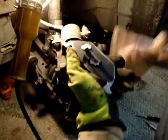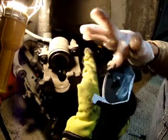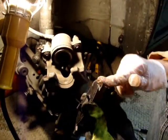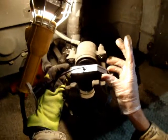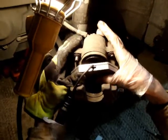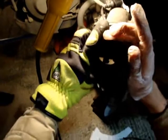I'm going to put this brake lubricant on any mating surface. I'll do that on both of the brake pads — you want to get the backs and also even where it touches here. I got that all lubed up, so I'm going to just push those guys right back in and they'll snap in like so. Be careful with that wire. The other one I've got all cleaned up as well — he'll just push down and snaps into place.